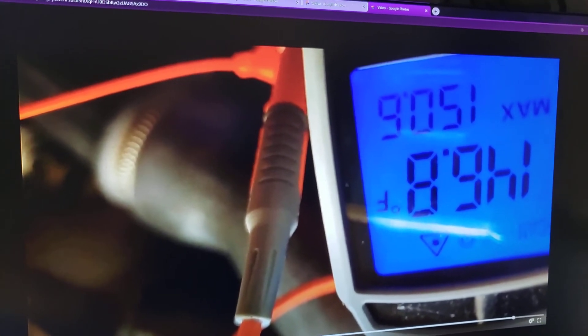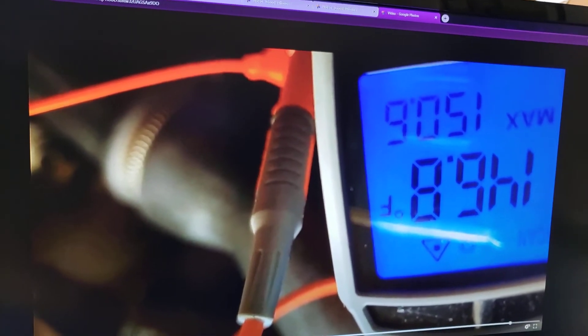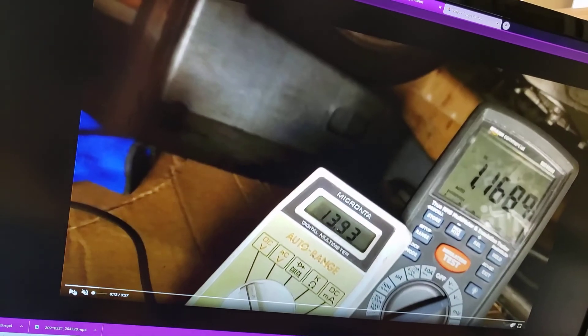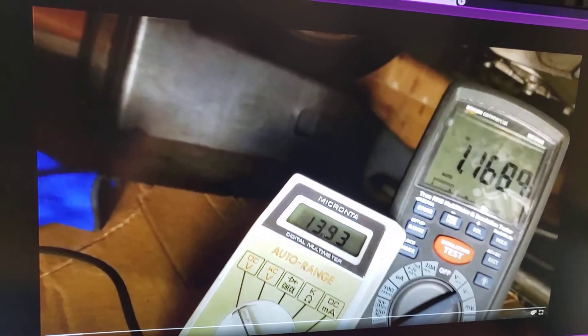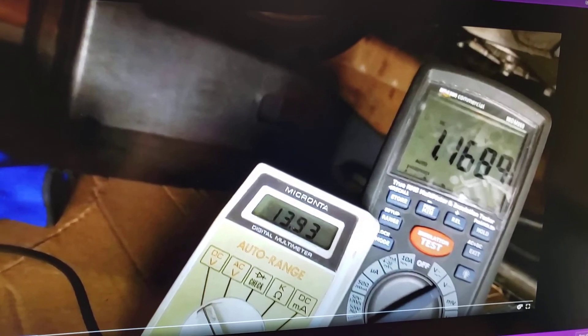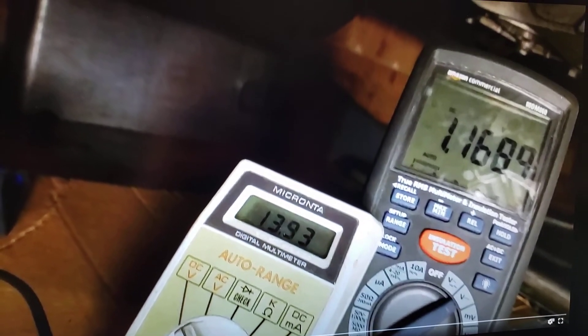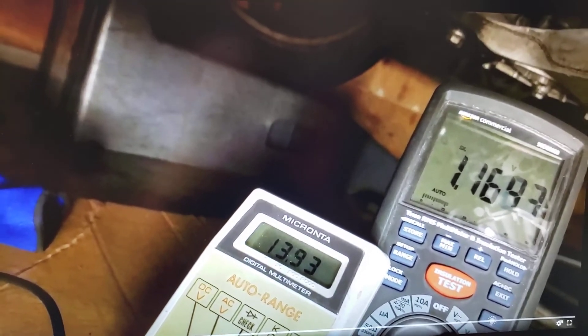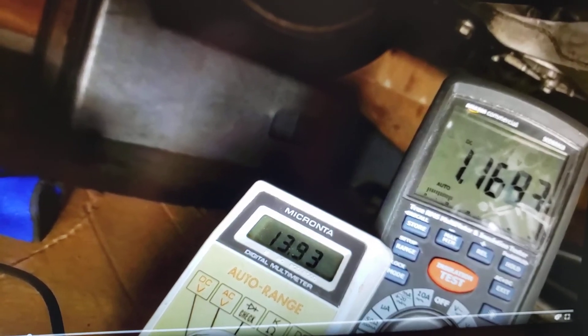Just wanted to share some of this information. One other thing I noticed: when I was running and idling the engine and testing the voltages, when the fans were not on, the voltage on the little green wire only got up to about 1.16 volts. The value changes very quickly, but it's somewhere around 1.15 to 1.16 volts. When the fans kick in, the voltage changes on that little green wire — it changes to about 1.80 volts.